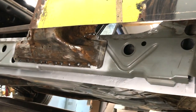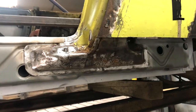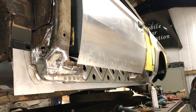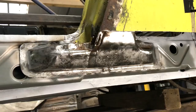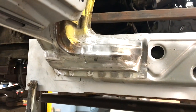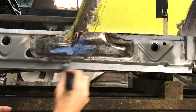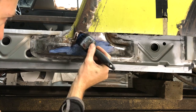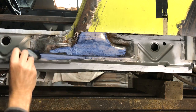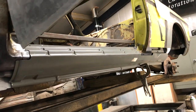I've replaced the rusted metal on the B-post reinforcement and now I'm repairing the A-post reinforcement. The reason these parts are designed like this is to do with the lack of a B-post to roof support, like you'll find on most cars. I've just made it up in sections to something like it was before, and done the same with the rear inner arch to sill. I've removed as much rust from these reinforcements as possible without media blasting. It would be better to blast these parts, but it's just not worth the vast amounts of extra time. The inner part of the reinforcements will still have surface corrosion — the best way to make sure this car lasts is to cavity wax everything you can. It will last a very long time if done thoroughly.